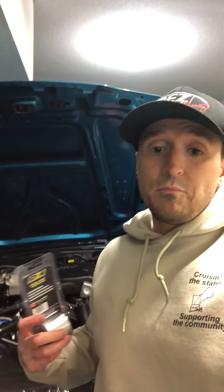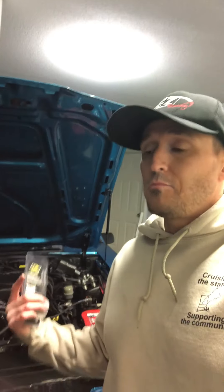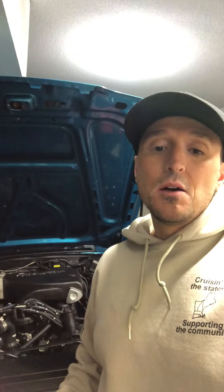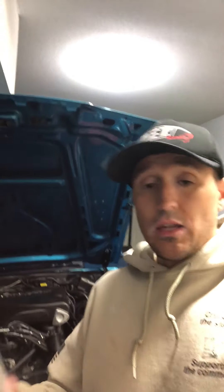What I wanted to show you guys today is something I found — a power wire, my positive terminal battery wire, running across the front of the engine. It's covered, but I did find a small spot where it's open. It has a plastic sheath somewhat, but I want something that can handle higher temperatures because I am running a turbo now, and heat is a destroyer. The heat from turbos, superchargers, and hot-side exhaust in these builds can melt your wires quicker than you can blink an eye.